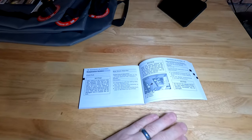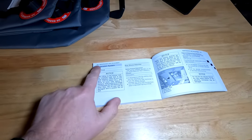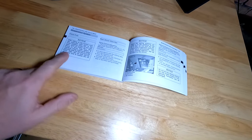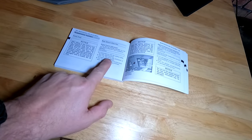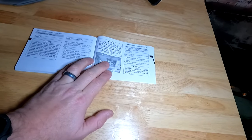Before I do, let me show you the owner's manual so you know where I'm getting my information from. This is the KLR650 owner's manual for my 2022 — pages 142 and 143. It walks you through adjusting the rear suspension. There's no adjustment on the front, but for the rear spring preload it actually uses a 12 millimeter socket, and the rear rebound damping adjustment is just a screwdriver.